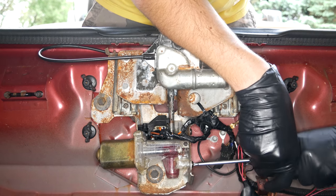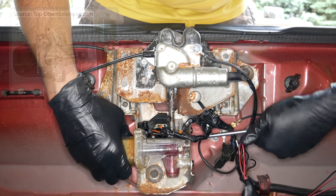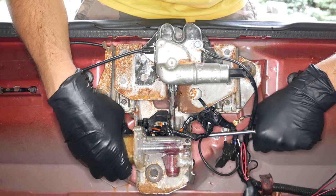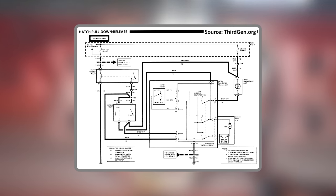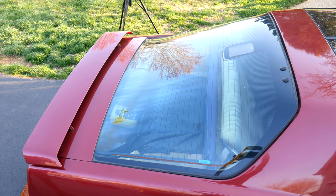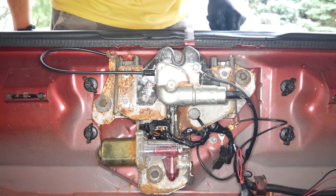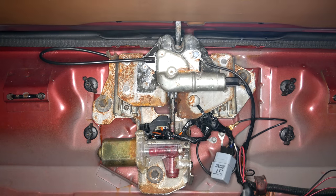Once the pin was reinstalled, we could slide back on its locking ring. With that secured, we reinstalled the three gearbox mounting screws - again being careful with the plastic threads. Unfortunately there aren't any non-plastic gearboxes available for these, but at least one company does sell plastic gearboxes that have been reinforced with epoxy and a few bits of metal. The plastic housing and main gear are also used to electrically isolate the motor from the body ground - due to the somewhat complex mechanism, the motor is switched on both ground and feed sides, so without some complicated re-engineering we're stuck with a plastic gearbox. As long as I'm gentle with the hatch, hopefully this one will last years to come. And here we go for the maiden voyage - we'll have to clean up some of that excess grease, but it does seem to be working just fine. It's a little sluggish the first few times, but pretty soon the grease gets pushed around and everything is moving freely again.